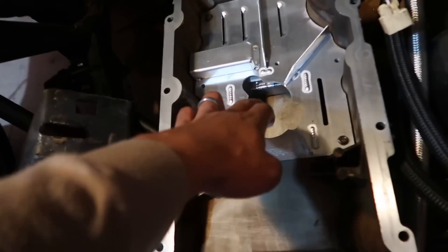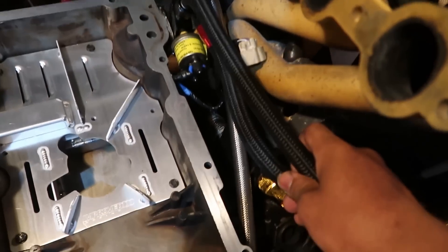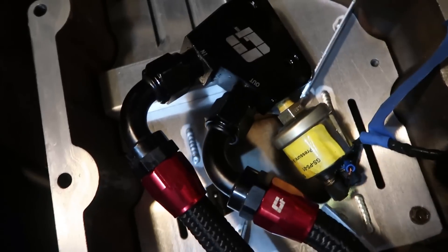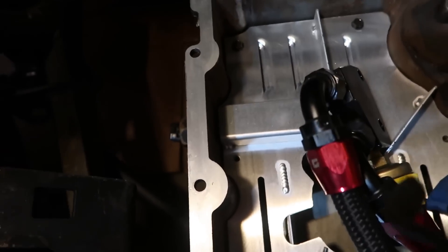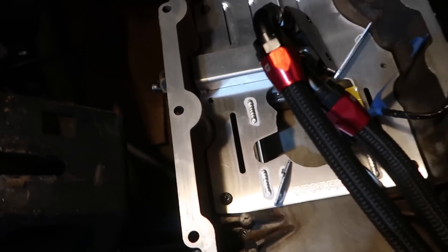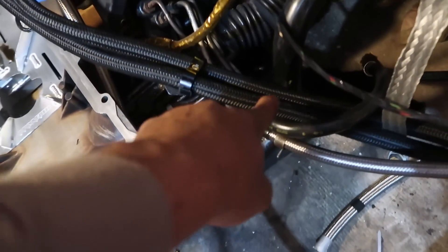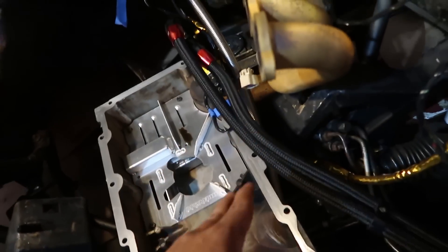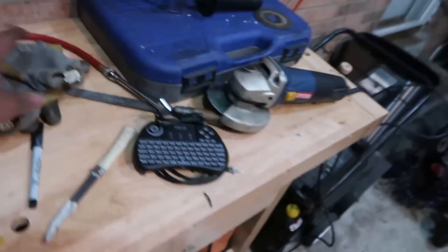I am going to give myself a little bit of slack in this line in case I have to move anything around. My oil pan — as you can see, I've got my baffles in there now — and my sandwich plate is going to mount to the side of the oil pan roughly in this area. On the sandwich plate they make it nice and easy — it says 'in' and 'out'. The return side is the side that goes back towards the motor, and that's the line we're going to be tapping into. Based on what everything looks like, I think I'm going to cut in this area here because I know I'm not going to be interfering with anything and it's going to be clear of the headers. Up here I think is a good area for me to splice into.